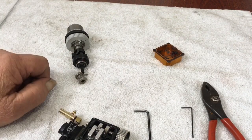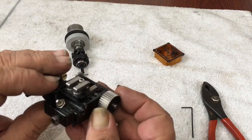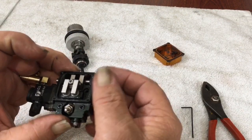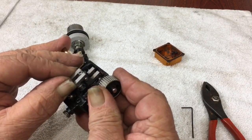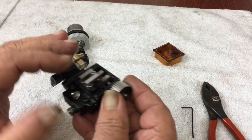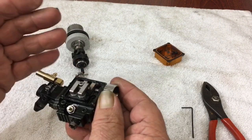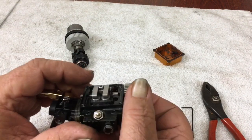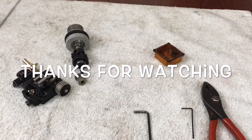So I'm gonna get on that now. Like I say, if you guys have one of these and you've had your rocker off or if you have your motor apart, see if there's any play in your rocker arms to your camshaft at top dead center when the mark is down. See how much movement you got in your rocker arm because I want to know — this is really strange to me. I'm gonna keep working on this and if you guys hit me back with some of that stuff, I'd appreciate it greatly. You guys have a good one — adios.